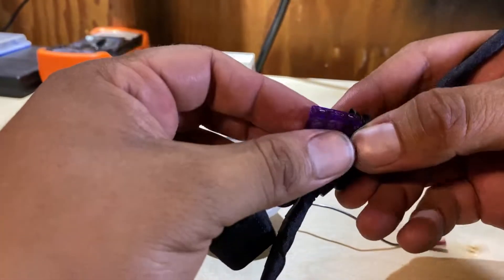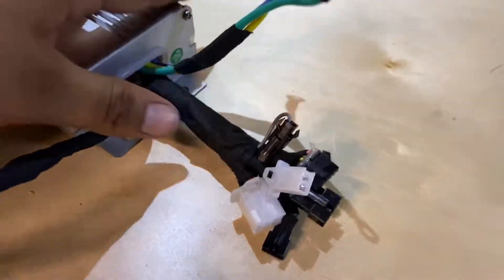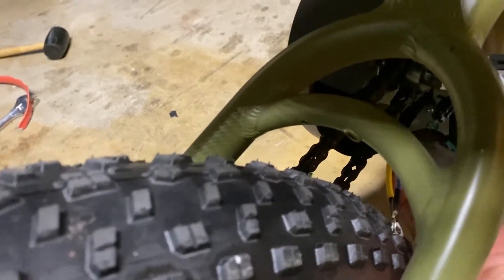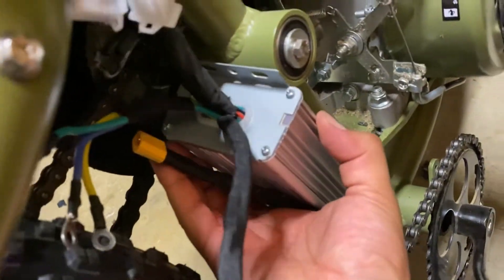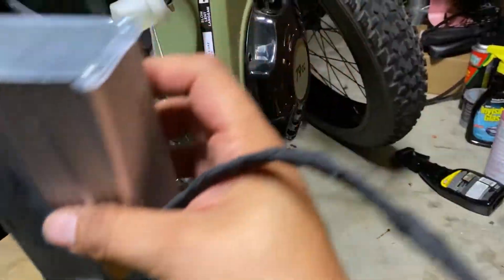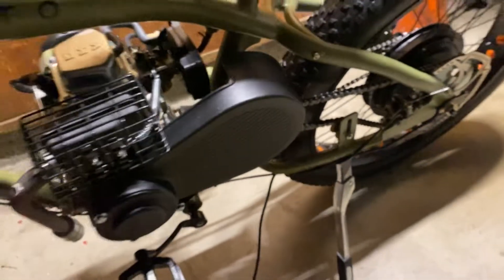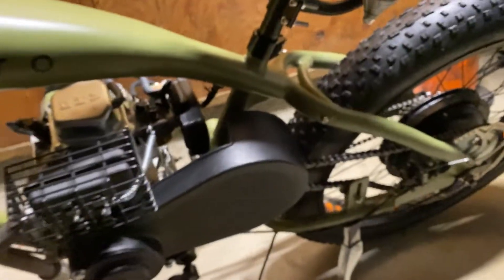Got these guys all tidied up, everything is nice and wrapped, the important stuff is hanging out. Let's see how this could fit on the fat moto behind this here. The reason I flipped that bracket was so it doesn't scratch anything, and I'll probably flip the other one as well. The motor cable I ended up routing through the inside of the dropout, just temporarily held there. The battery should be able to go right there somewhere, and we'll put the controller behind there.